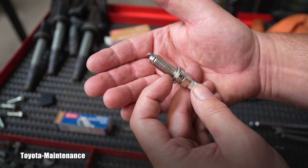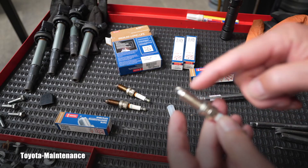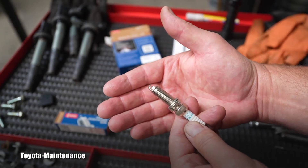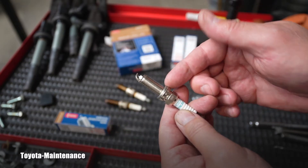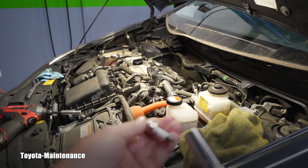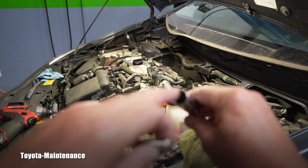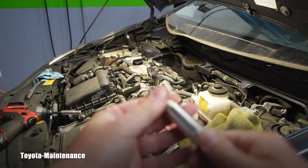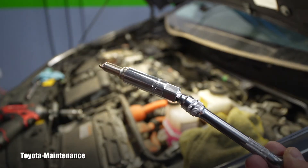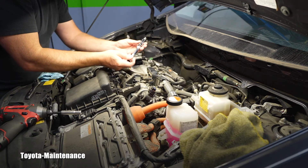That crush washer is why it's so important to use the correct torque procedure. We'll be specific to these straight plugs — there is no conical shape, it has a crush washer. First, I'm going to take the brand new spark plug and insert it into the socket. For those new to this, there is a rubber part inside the socket which will hold the spark plug in, so it won't fall out. I'll then go to the engine — number one was already done, number two was removed, so I can show you how to install it.